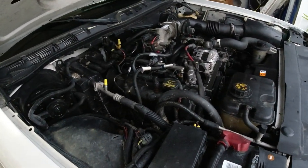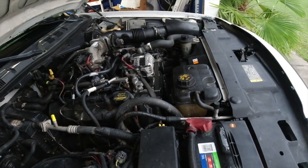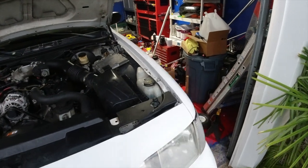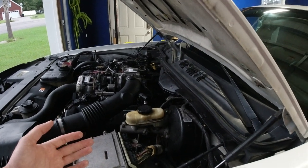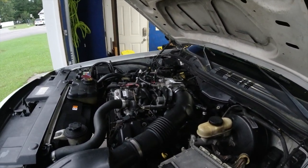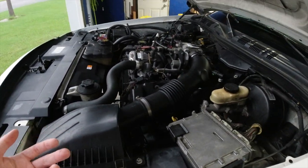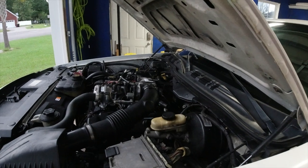So basically it's going through this whole vehicle, figuring out everything it needs. I was missing a cap there — I actually had it with some wires and it worked out putting it right on there. The main goal is to make sure everything is working in this vehicle. And then clean out the brake fluid — there's two ways you could do that: completely bleed out the system, or just siphon it out and add new fluid in. You can do it both ways. When I had a race car, that's sometimes what we did — it's not probably the best thing to do, but it does the job. The power steering — it's just everything. The biggest thing important to do is checking all the fluids and getting all of that working.